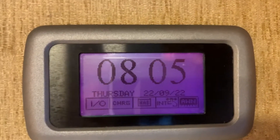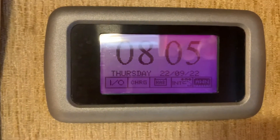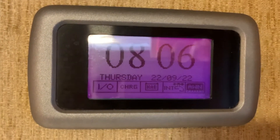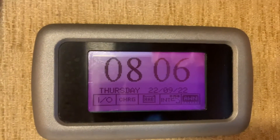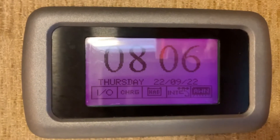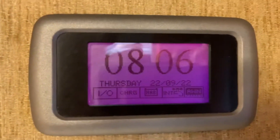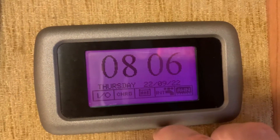Just a quick note on this: this isn't so that you can switch over to your vehicle battery if your habitation battery runs out. Never run your leisure vehicle from the vehicle battery when you have a leisure battery fitted. This is purely so that you can use the onboard battery charger — which runs from mains electricity — to charge both batteries at the touch of a button. That's what it's for.